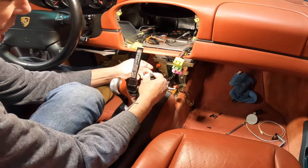Pretty easy. This one's a little bit different. So the plug here plugs into this, and what you need to do on the underside of this is get a little screwdriver in here and move that up. Make sure you pinch these so it will come out of the dash here. So pinch that, get those loosened and pulled out a little bit, get a little screwdriver in here, just easily, you know, force it out, wedge it out. And then on the bottom here, all there is, is this little pin right here. You just move that over a little bit and this thing drops right out. So really, really super easy. So that said, I'm gonna go ahead and put all this stuff back together. You guys don't need to see that. And we'll be back to kind of start buttoning all this up.